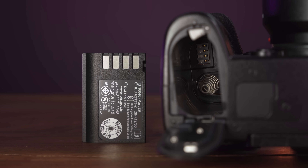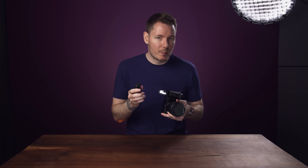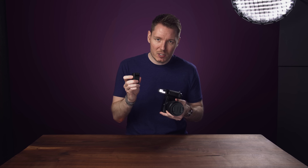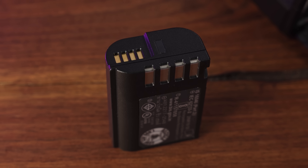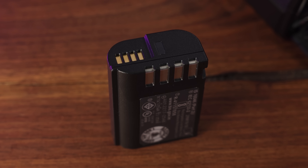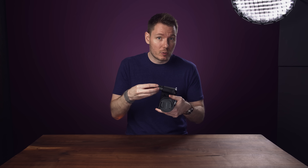It gets a bit stranger when we look at the battery. This camera is using a new battery type, which is also sort of a hybrid between the S-series and the G-series with some backward compatibility. Judging by the pinouts on this new battery, it has the old-style connector from the BLF-19 that you'd find on the GH5 and G9, but also this new set of pins for the S5. So, you might be able to use these batteries in your old G cameras, but I don't think your old G cameras will work in this camera because they don't have the new pins, and neither are compatible with the S1 or S1H. This is pretty peculiar if you ask me, but thankfully the battery life was pretty good.